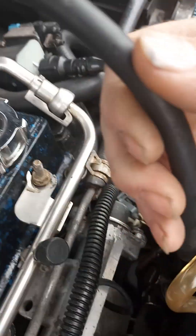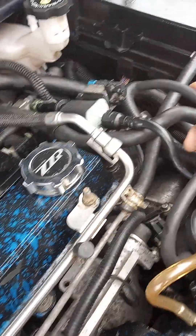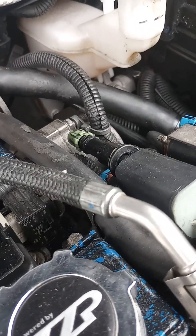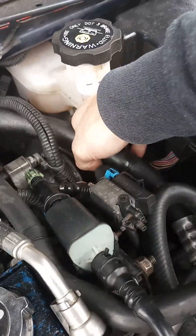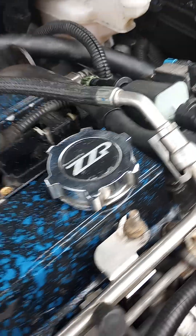Now that we have that covered, the bottom hose is free air. You don't want that connected any longer to this. The reason why I don't have the hose leading off the back of the actuator to the manifold is my manifold hose is now directly linked to my boost gauge inside the car. I did the actuator delete with the boost bypass.